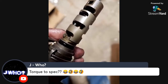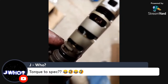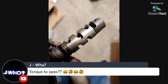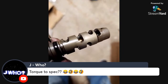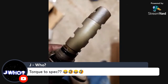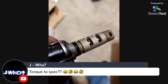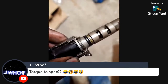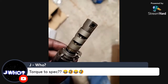That's right. Most of the time, what happens whenever you get debris up there is whenever somebody does a repair and there's silicone on the car, and they use some kind of angle grinder and buzz the silicone off, and it gets in a fine powder in the oil pan, and then it goes up and clogs up that screen. I would bet you if the engine's not real gunky, it's probably going to be fine.